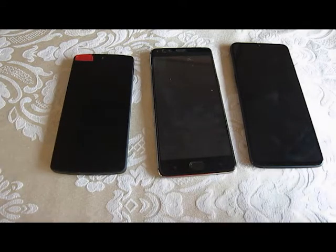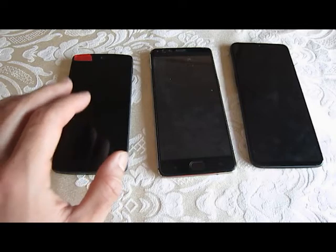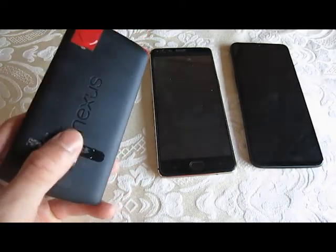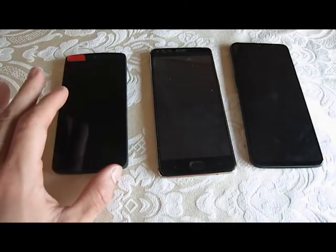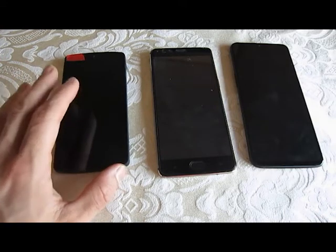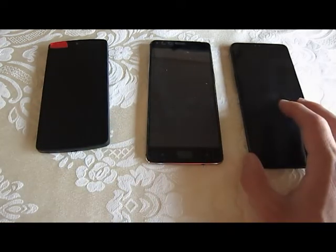You do still have to be careful when looking at devices with official Lineage ports, because the bootloader has to be able to be unlocked. For a lot of these phones, it's quite simple. If they're already factory unlocked, you can just fastboot and unlock the bootloader. But if they are tied to a carrier, you might run into additional problems.